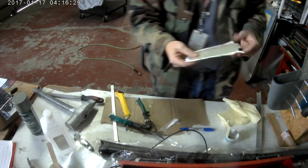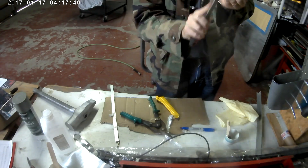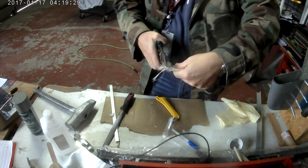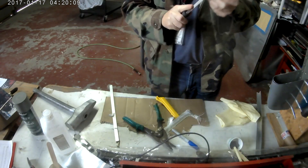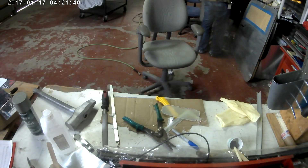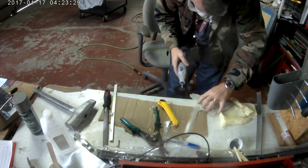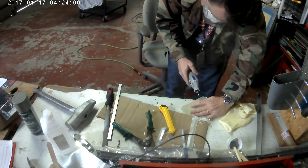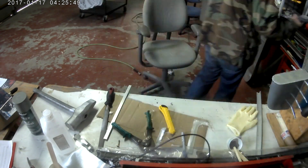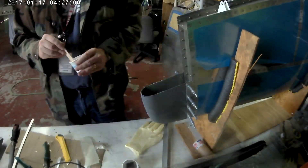That's the second piece I've made here — fiberglass is pretty simple for flat work. Now once you get into complex molding and forming, that's a whole different mess. You're talking about form molding, definitely having to wax the form, and you may want to vacuum bag seal it to make a smooth, even surface. But for the purposes of what we're doing here on the Van's empennage area, all we're doing is plugging holes with flat sheets.